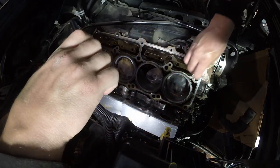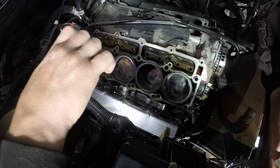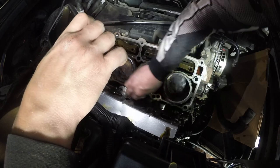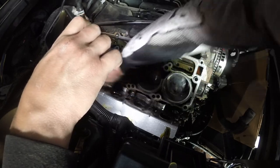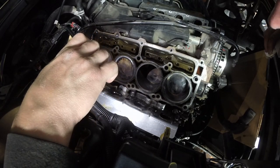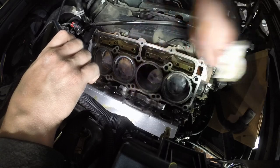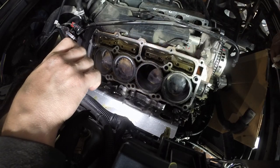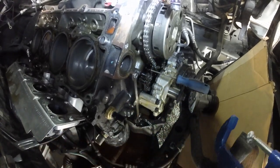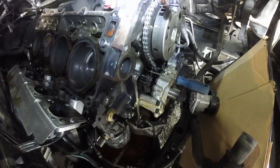Okay. Yeah. The pistons look okay. I don't see any flakes or any chips. You should be able to get in there with your drill pretty good to get all cleaned up. We'll just put some rags into the cylinder. Cylinder's good, so nothing's falling in there. If it falls out, we know we can clamp it in, so I'm not too worried.